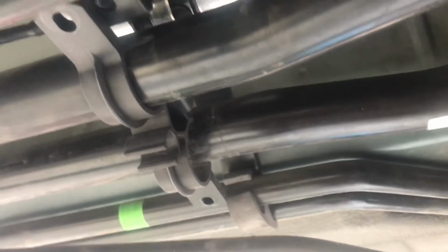One quick thing to add when it comes to reattaching these two plastic retaining pieces. I put this one on kind of halfway here, and then I went up and I got this other one started too, because if you attach one of them, it's going to make it difficult to attach the other. So in this position here, it kind of leaves a gap between these two coolant pipes. So with that, come up, and then you should be able to somewhat easily reconnect this one here, and then come back, work on reconnecting the other one, and then just make sure that you get the hanger up and over. You can see where it's supposed to sit in that piece there. So nothing too difficult.